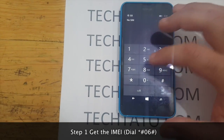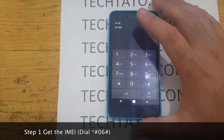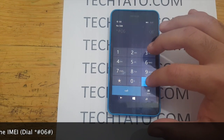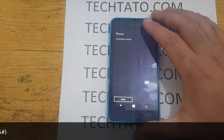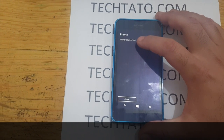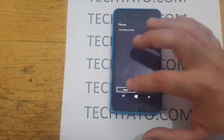Now, one of the most essential parts of the unlock process is the IMEI. Dialing asterisk-pound-zero-six-pound will display 15 to 17 digits on the screen. We'll use that as a reference for submitting it at my website, where we will request the unlock code and send it back to you so you can finalize the unlock process.